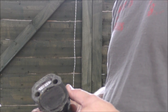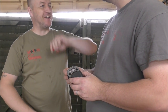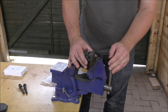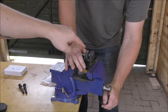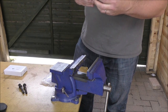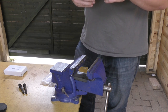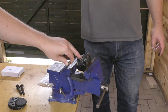We might have to pop along and use an air compressor to blow the piston out. Actually, I bought an air compressor — and a blowy punchy thing — so we can do it here. I'm going to try and push it back first, just stick it in the vice and see if we can push it in without using the compressor. It's moving — I can see the fluid bubbling out. When you release it, it comes back in. It's moving a bit, it's not seized solid. If we can get this pad out, we might be able to free it off. The piston's got a rubber seal around it so it should be okay.